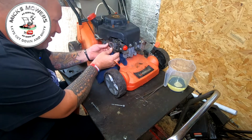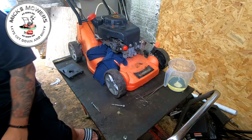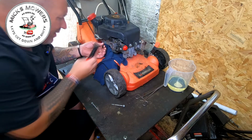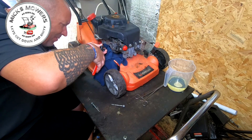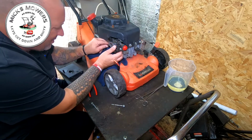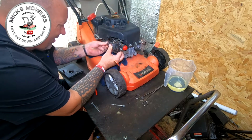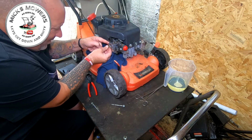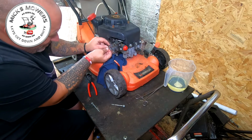That'll help. I'm going to snip a little bit off of the front of that fuel pipe, because I'm sure as I took it off, it had a little tiny split in it. So I'm not going to remove a lot of it because there's not a lot to play about with, but just enough to give me a good fixing. So fuel pipe on, and then the hose clip goes on as well, which are easier said than done on these little things because you've got to push them on.